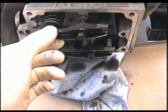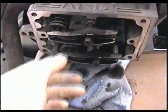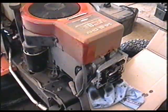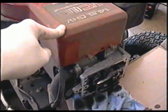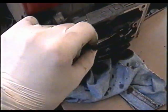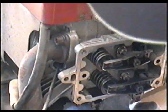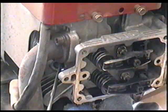There are the valves and the arms that open and shut them. They're already loose at a first glance. Sometimes they can get so loose that the pushrods can actually come out of the groove and your engine won't run anymore. Now what we need to do is turn the engine by hand until the piston is at top dead center on the compression stroke, which means both valves are going to be shut. The way I do this without removing anything else is I grab a thin screwdriver and insert it in the spark plug hole so that I can feel the top of the piston.